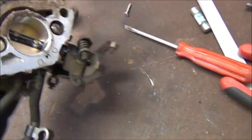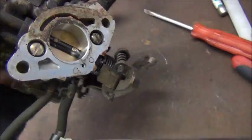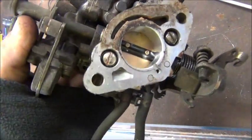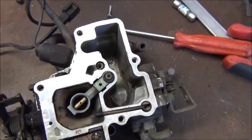I'll show you the size of it — what is it, 25mm, maybe 30mm throttle bore? It's only a 550cc engine so what do we expect. You can see all the varnish and crap on the outside — I expected it to be like that on the inside too, but it's not, because the turbo is constantly pressurizing the carburetor, which I think keeps it rather clean.